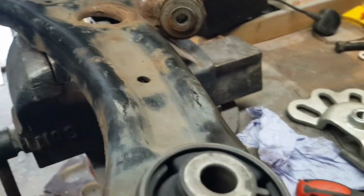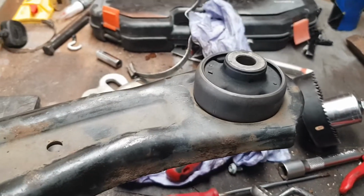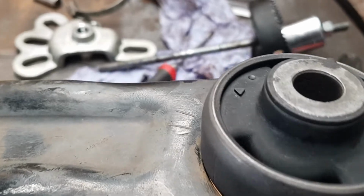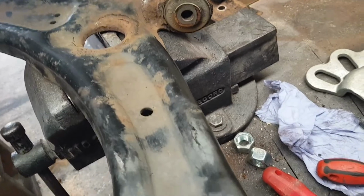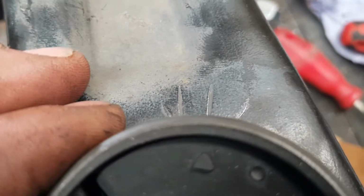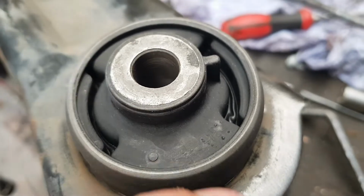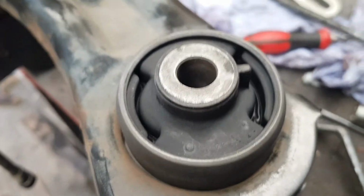So when it's on your car, like that, the play will be all good. Rubber will work. So yeah, that's how I line it up anyway. That angle there. The time I've looked at one, these rubbers are pointing up against there. So yeah, that's how I do it. So I line that up, do exactly the same as the other way, put the bolts on this side here, or the nuts on this side, use the vise, pop it in, put plenty of grease on it, let's get it done.